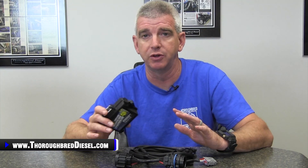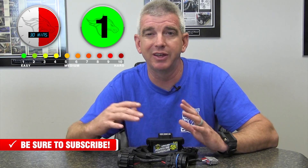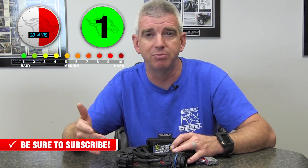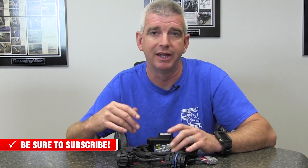Let me talk to you a little bit about why you need it. For you guys that have stock trucks or tuning on your trucks, this is going to help you save your transmission. The stock Ford programming in the 6R140 with the Power Strokes runs anywhere between 70 PSI and 170 PSI, depending on the workload. They do that to save work on the transmission, get better fuel economy when you don't need full pressure running through it — reducing parasitic loss.